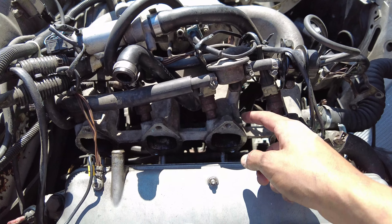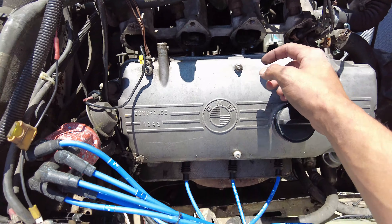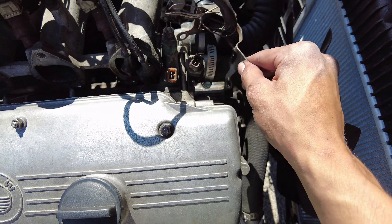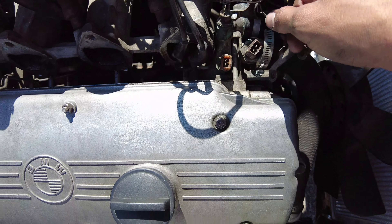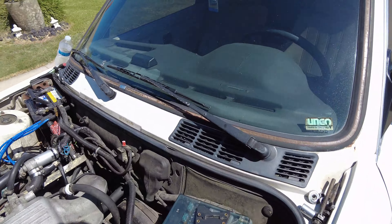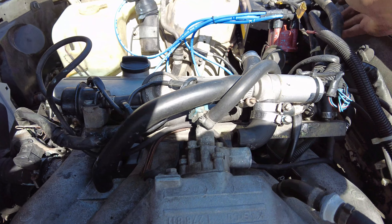What you're going to need is a 12 or a 13 to take off the intake manifold bolts that are holding it together. Then you want to take out this vacuum hose that's connected to the valve cover. You also want to disconnect this assembly right here — it's only three bolts: two 10mms right here and then a 13 right there. Then just unplug all these sensors right here.